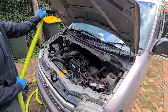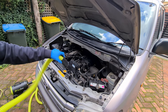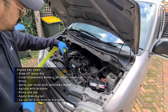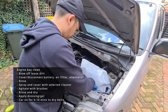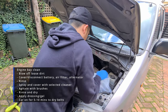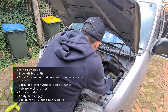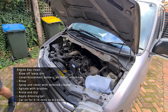The first thing I like to clean is the engine bay. You can skip this step if your car is newer and your engine bay is already looking pretty clean. For here, we're going to blow off any loose dirt — I'm using the Big Boy Mini Car Dryer, but you can use a leaf blower. Next is to cover or disconnect the battery; I'm just using a plastic bag here and it works just fine. You also want to cover the air filter if it's exposed, and normally I like to cover the alternator as well, although it's not necessary from what I've been told.